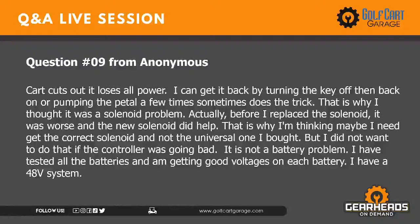Oh, okay. Yeah, that's what I was thinking. Harris, you're talking about the shocks. No. You're going to laugh when you take that shock off, because it's not doing anything. It's not holding your car up. You could remove your shocks and you wouldn't even tell they were gone, and you could go ride your car around. Your springs are holding your car up. You'll be able to compress that shock with your hand, and pull it back up with your hand. So don't worry about that shock. There's nothing to it.